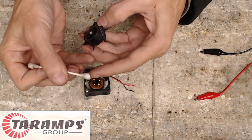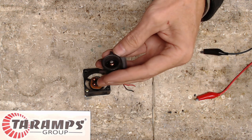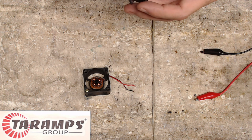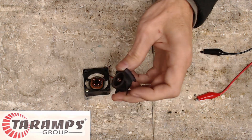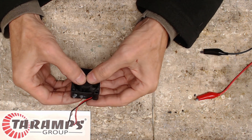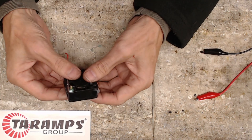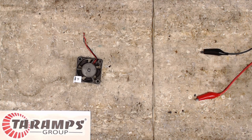I just make sure all the isopropyl alcohol is cleaned up from within the fan section. Use a dry Q-tip to make sure I got all the grease out of it. Then I lightly spray just a little bit of CRC into it — just a little touch. Then we just slide it back together until it bottoms out. Check the fan — sounds good.